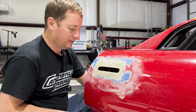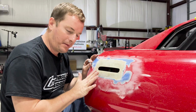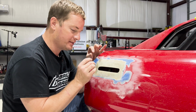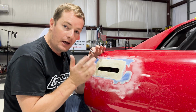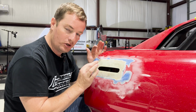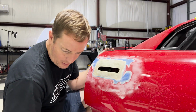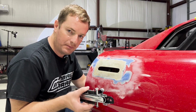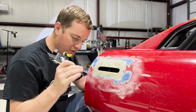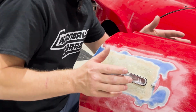What I'm gonna end up doing then is from the back side, I'm gonna slide this through. I'm gonna do some fiberglass repair over the bolt to hold the bolt in place. And once the bolt is held in place, it should be nice and secure in theory. Not only am I gonna do that to the front side, I'm gonna do that to the back side as well. And this should secure our handle and give us enough adjustment height-wise. I'm not quite sure yet if it's going to affect the handle the way it moves up and down. We'll see. I think if I put a washer somewhere in between those two nuts, that will hold this in place. Sweet. All right, the handle is securely in place.